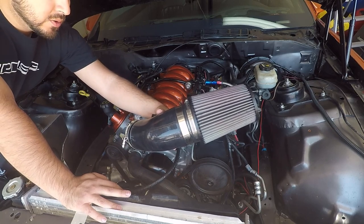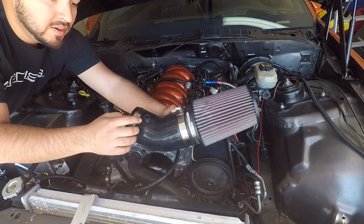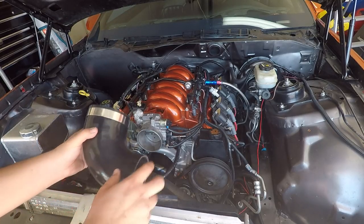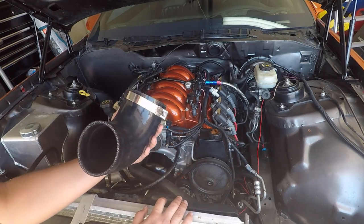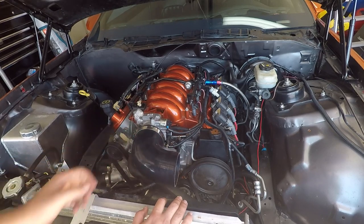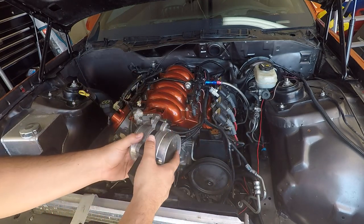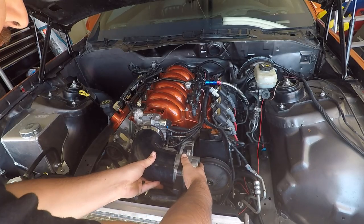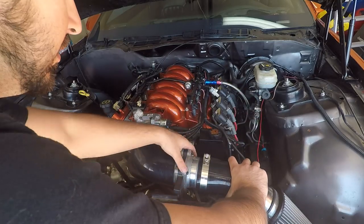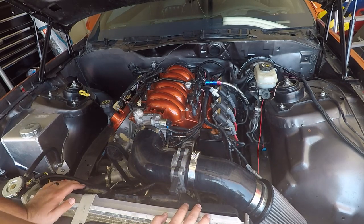As far as your air intake temperature sensor goes, I went ahead and just poked a hole in my silicone and slid the sensor right in — this is how easy everything goes together. Make sure you remember to buy your clamps; there are different clamps for different diameter sizes. So this piece literally just slides on like that. Put on your MAF sensor — make sure the arrow is going towards the throttle body — slides on like that, and then the last piece slides on like that. Tighten down all your clamps and that's basically it.